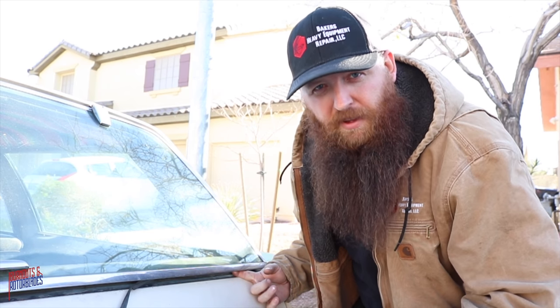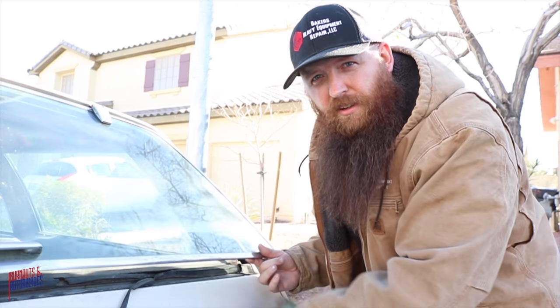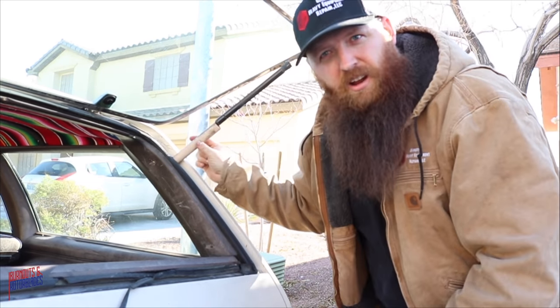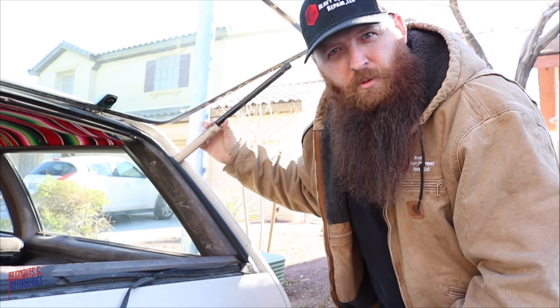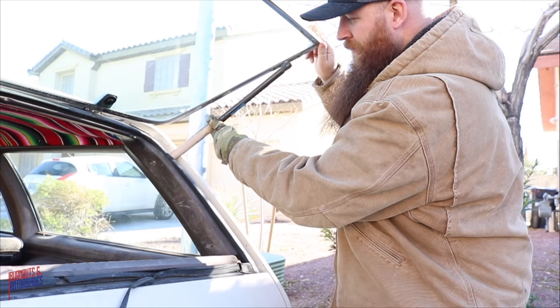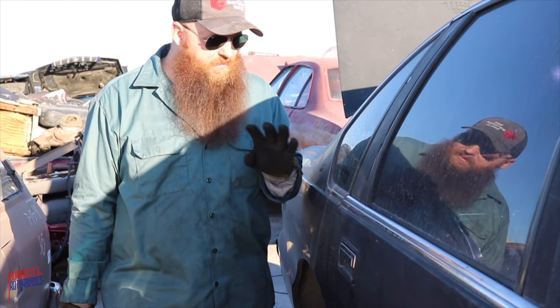And if you're like me, and by that I mean cheap, you may also have an old wagon window that's just not staying up the way it used to. Well, there's an easy fix for it, and I'll show you right now. An offcut of PVC pipe will lock right in on the edge of that gas shock to hold it up. Problem solved.